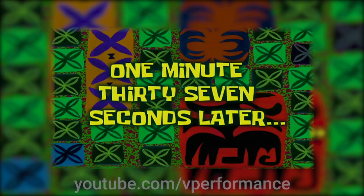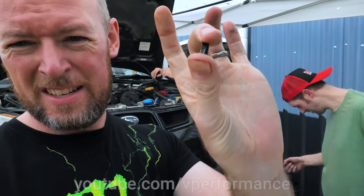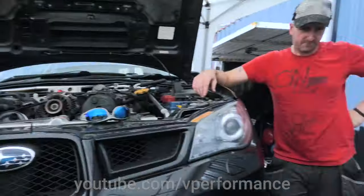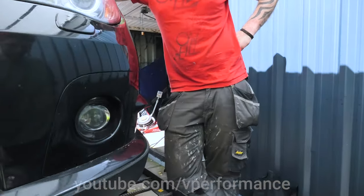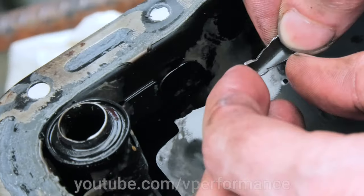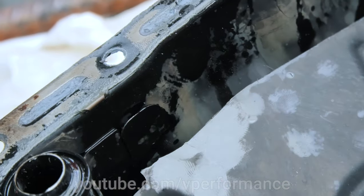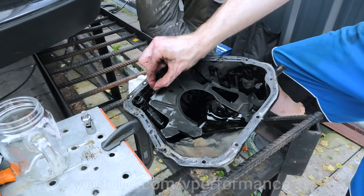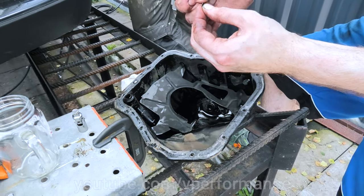One minute 37 seconds later. So following some panic and disaster where we found a piece of metal in the sump — this little piece here — it's a teeny tiny little bit of metal and it doesn't look like anything we recognise, like con rods or bearings or anything like that. But where it has come from is this tiny corner — it's literally a tiny little piece of a windage tray. So it looks like over time that has deteriorated and broken off. That is about as good news as you can get, because we've gone from budgeting for an engine to — actually it's totally fine. So if you ever find that piece of metal in your sump, don't panic.